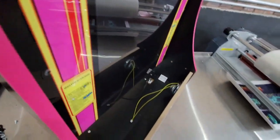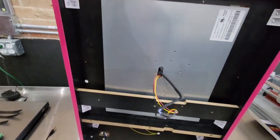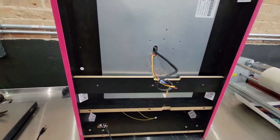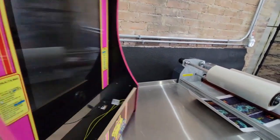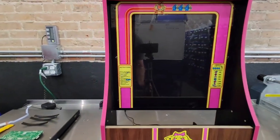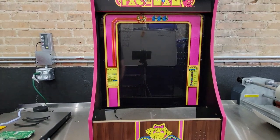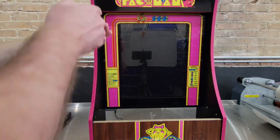Then on the back side, I've already removed the actual game board, so you'll be looking just like that. Unfortunately, with almost every Pandora I've ever installed that has a vertical resolution, the Arcade1Up LCD is always upside down, and this one is no exception. So the first thing you're going to have to do is physically rotate the monitor. The Pandoras don't have settings to do that, unfortunately.